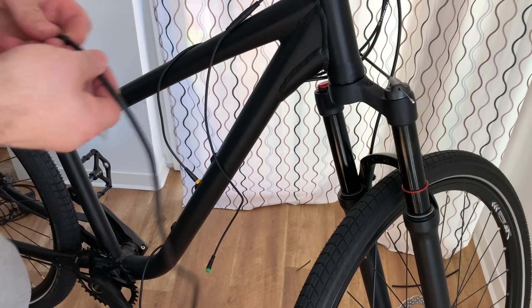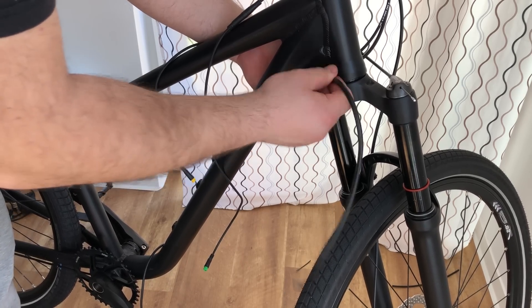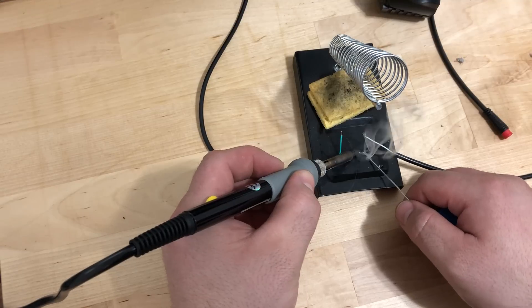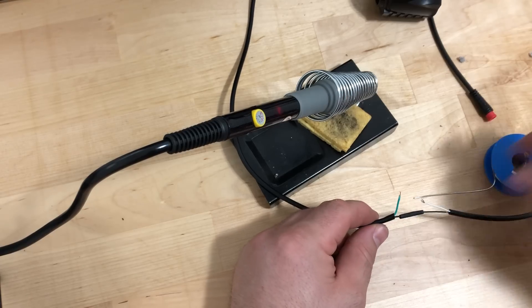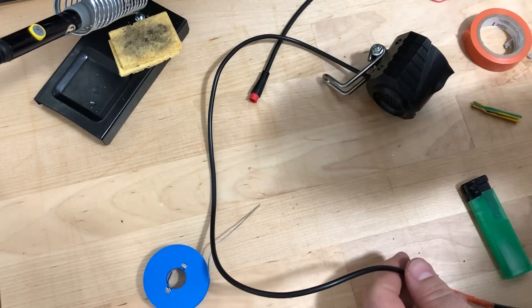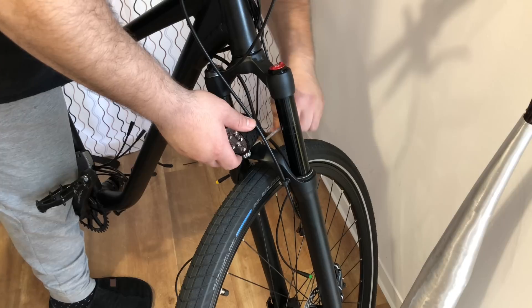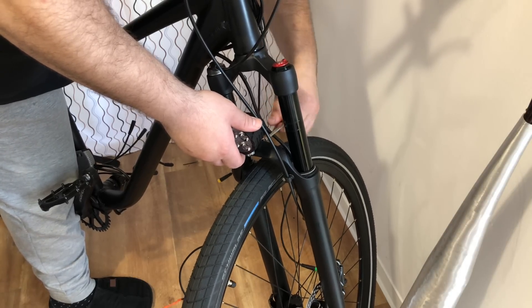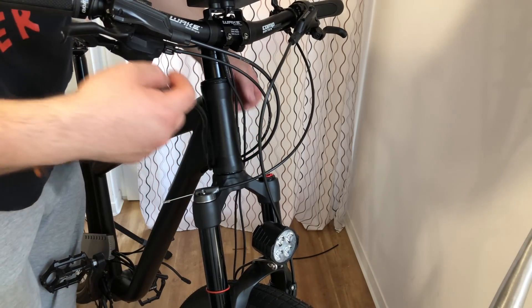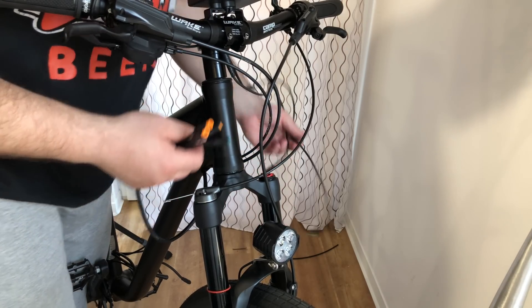This is the 4-in-1 cable which is used to connect the LCD screen, throttle, and the brake levers. I will feed the cable inside the tube and take it out from the other side through the hole I created. Afterwards I will solder the light with a proper connector — I couldn't find a light strong enough with a proper connector so I decided to purchase them separately. It's important to have a strong light at night, especially when riding an e-bike at high speed. Make sure when buying an e-bike kit that your controller has a light option — it's something you don't think about but will wish you had.